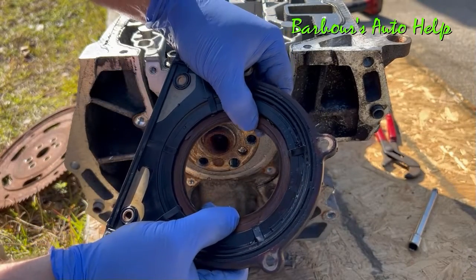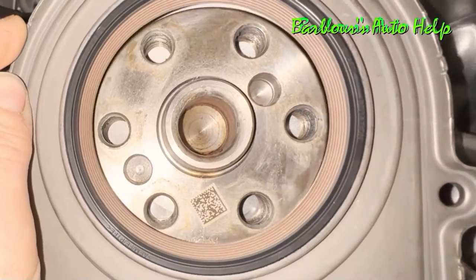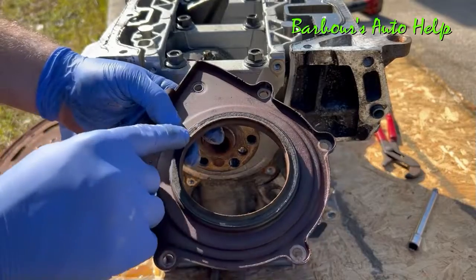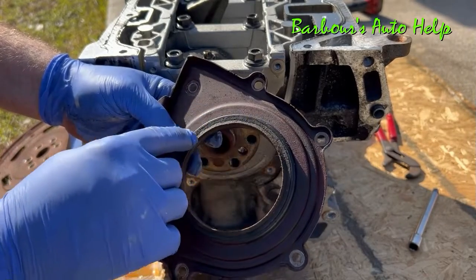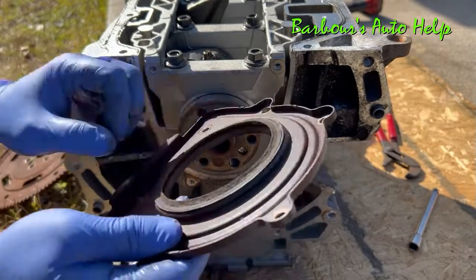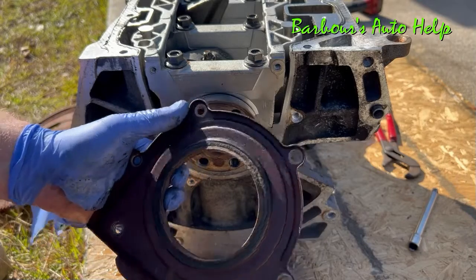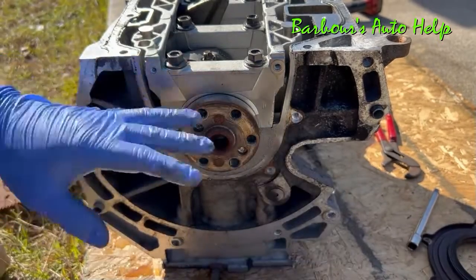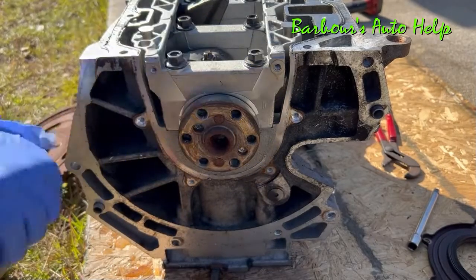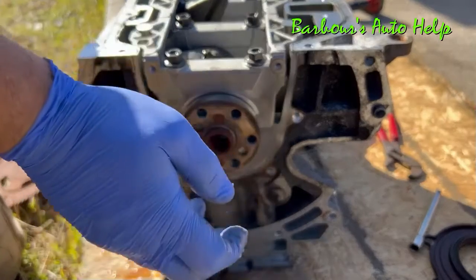When you originally get this seal before you put it in, it won't look like that — it'll be kind of flattened out. There's a special tool you're supposed to use to install it so that you ensure the lip is going inward. Also, you can see the outside lip of this seal has a fuzzy appearance on it. The new seal will not have that fuzz. So whenever you find that the lip is fuzzy like this on a 2.0, it's probably the original equipment rear main seal and has probably never been replaced. I've got a video explaining this in more depth and I'll post a link in the description. A really important point about the orientation of that lip.